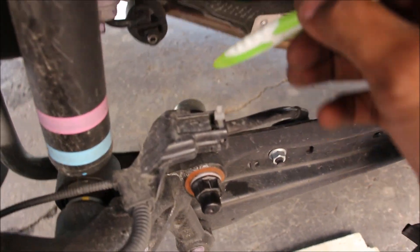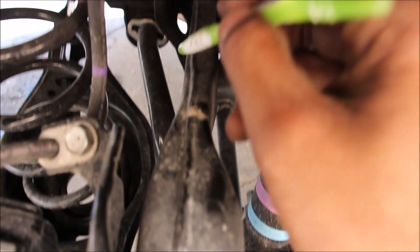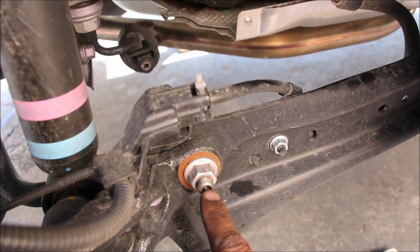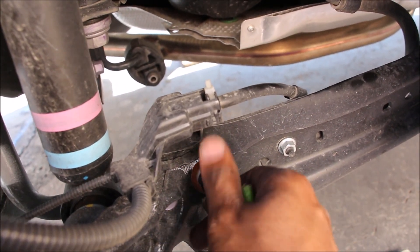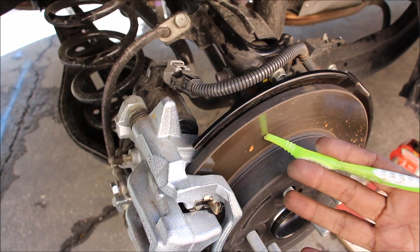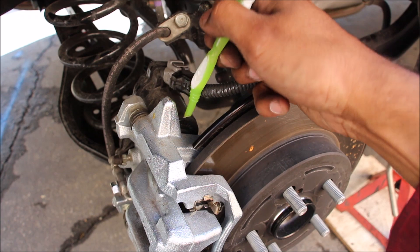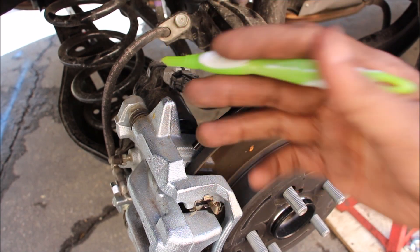Attached to that control blade at the back is the stabilizer link, which goes to the sway bar and over to the bushing on the other side. What's unique here is this little nut facing the wheel could get dirt and grime in the threads and internal hex, so they've actually included a neat little cover so that when it comes time to replace the sway bar link, that hex doesn't rust out and strip. The rear brakes are fairly straightforward — just a single piston caliper that squeezes this disc rotor. The parking brake uses the much-hated electronic parking brake setup with a little motor actuator inside that squishes the disc together when you put the vehicle in park.